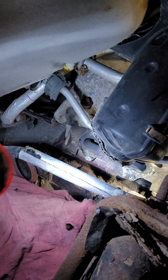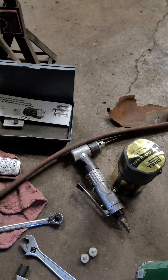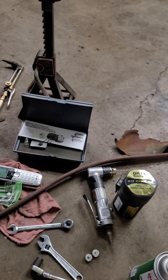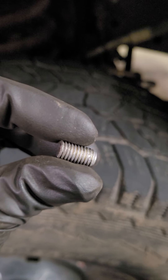It still will get off center a little bit, so you've got to double check it. But a lot of these other ones I honestly drilled by hand, just with a right angle drill and a really good drill bit. I got this Drill America set — it works really well for these, just using the 1/8 inch drill bit. Here's some more of the ones I got out on this side. I just drilled it by hand, heated it up, used the easy out, just using the oxy-acetylene torch. Works pretty good.